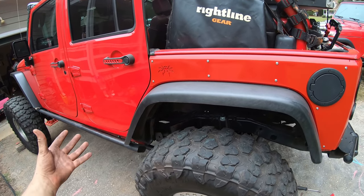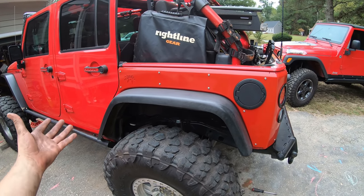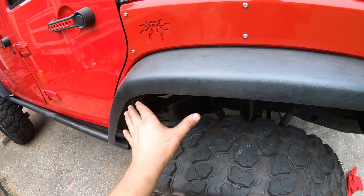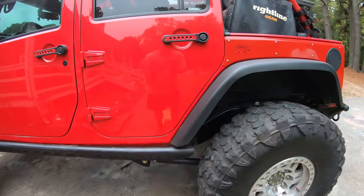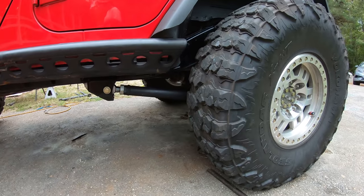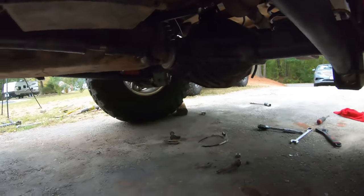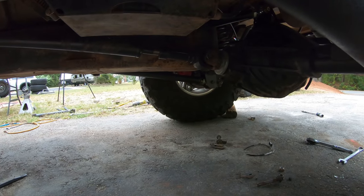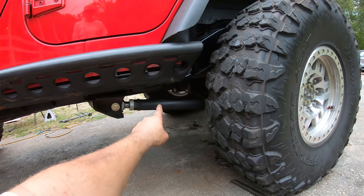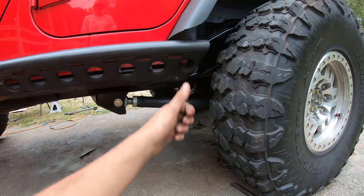Actually, it's a great idea to leave those old upper brackets in place. If we're out trail riding and have an issue with our single upper link — if it breaks or something bends — we can bolt in a factory or aftermarket adjustable upper control arm and continue off the trail. The lower link is in and our pinion angle is set. For rear pinion angle, you want it pointing right at your transfer case — pretty much in line, maybe a hair down. You adjust it by making the upper arm longer or shorter, or adjust the lowers by making them a little longer to bring the pinion down.